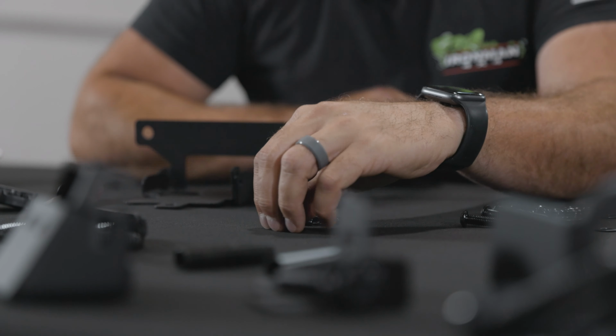Okay, the grill's out. We need to remove this top louver. So what we'll do is we'll flip it down. Make sure you're keeping yourself oriented in the right position here. So left, driver's side, we have this bracket right here. If you look down, it's just clipped over. So we'll pop the front one off. You'll feel it kind of click. 1, 2 in the middle, 3 in the back. So as you start to work these, you can take it from the back side and pull up, and that will unhook from all 3 of these louvers.